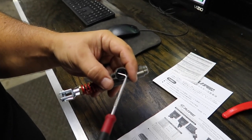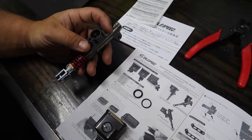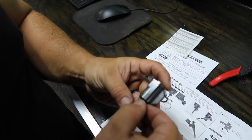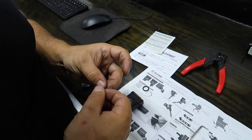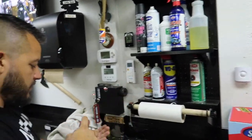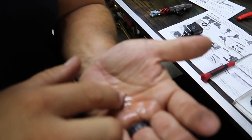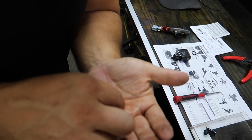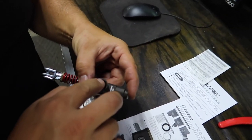You've got to make sure you don't scratch anything up taking this O-ring out. They supply the little one. I thought they were going to have us put it around here, but apparently it sits on the face — rubber to the face. I do like to lube these prior. I don't use brake fluid, but I do shoot it with a little bit of WD-40 because it's thinner. All you master techs that went to school — you can tell me why WD-40 is bad. It works great, never failed me.